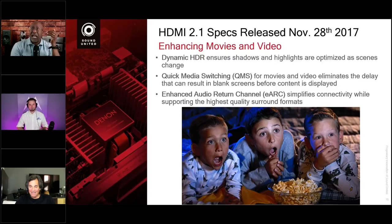Let's talk about dynamic HDR real quick, because you were talking about the fact that if you do not have the brightness capability of the mastering display, being able to reach the peak brightness, you have to make what's called tone mapping decisions. And one way is by using static metadata, the brightest pixel in the movie and the brightest frame in the movie, but the whole movie could be like a dark alien movie and your whole system is all looking wacky. We have plenty of examples.